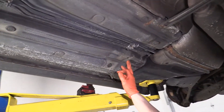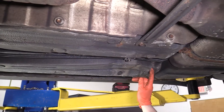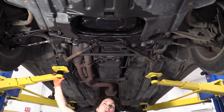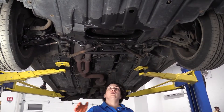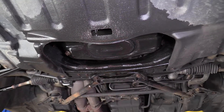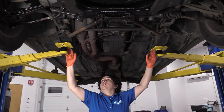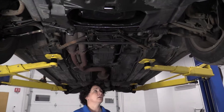It looks like someone even put a floor jack here. You can see this two-pinch right here — this is the actual floor. It's not the pinch rail. Even though it looks like it is, it's not the body rail. So if you have a floor jack at home — not the car jack, but an actual floor jack — and you were going to put jack stands on this, you could slide it underneath and set it right up here on this cradle. Center it, put it in the center, jack the car up, and then you could put your jack stands on where I have my lift points. Then your jack stands will be sturdy right here, and you can lower the jack and get it out of the way.